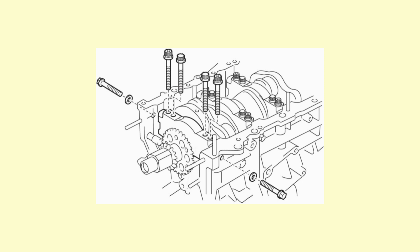These were not your ordinary high tensile fixings. Instead, they were engineered to stretch a precise amount in length as the bolt was tightened to a specific torque. This provides a consistent clamping force to secure each cap to the block, allowing Lexus to effectively resist lateral vibrations generated at the crankshaft by the alternating firing of cylinders on opposite banks of the engine.